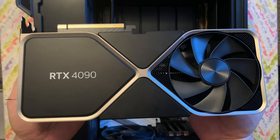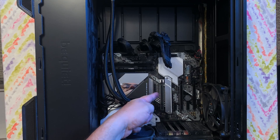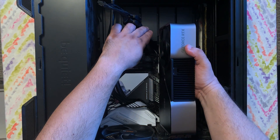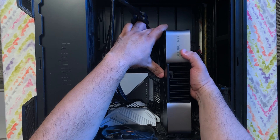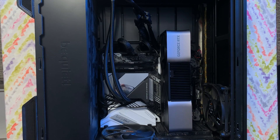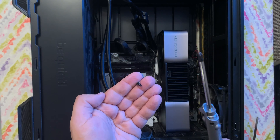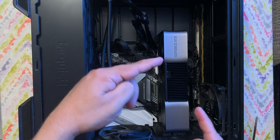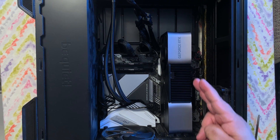Now it's time to install the RTX 4090 Founders Edition. As a rule of thumb, you always want to install it in the PCI Express port closest to your CPU. My CPU is right here, and there we go — it snaps right in. I'm going to get the screws and secure it. It helps to have a screwdriver with a magnetic tip so the screw doesn't fall. Sometimes you have to press the graphics card in to align the holes. The RTX 4090 Founders Edition is a three-slot card — there's really just a tiny fraction of space between it and the next PCI Express connector. All three screws are nice and secure.